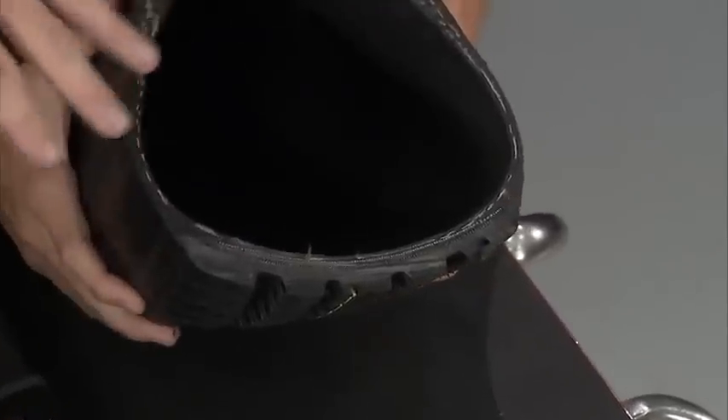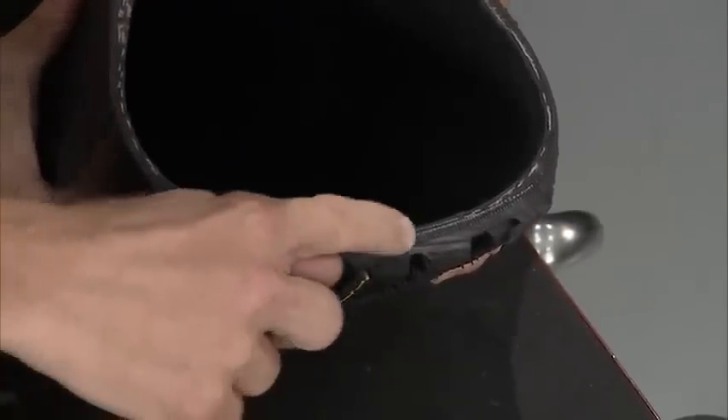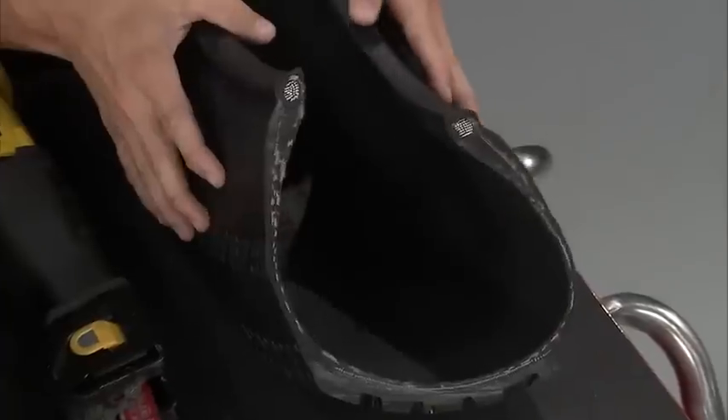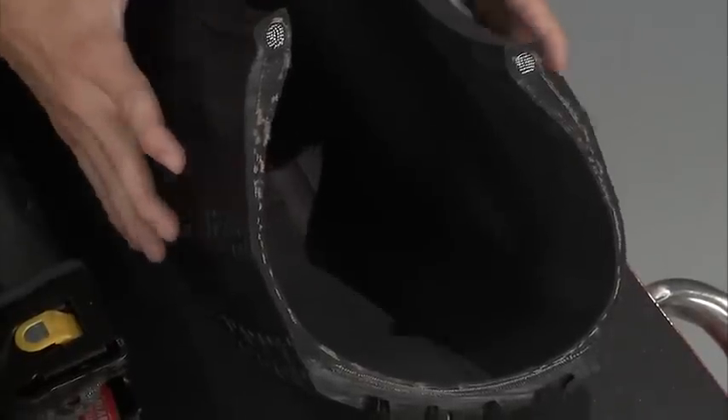That's the whole high-strength belt package — what they call Dura Trail technology — and it consists of three layers: a nylon layer on the outside, two steel belts on the inside, and two poly plies inside of that. The whole idea is to keep the tire together nice and tight. Where a truck tire might start pulling apart at the plies and generate a lot of heat, this keeps everything meshed tightly together and helps dissipate heat, which is one of the biggest problems with trailer tires. They also have what they call heat shield technology, which encompasses a specialized rubber compound throughout the tire that also dissipates heat. All of these things work together to keep that tire as cool as possible and make it last as long as it can.